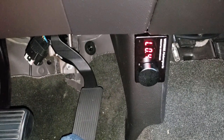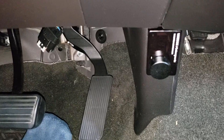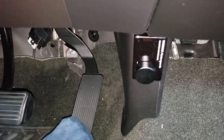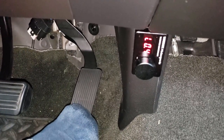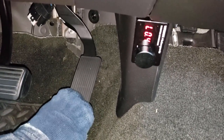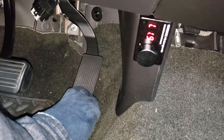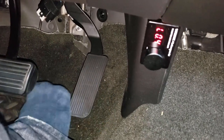We got the new pedal installed. After I took the old pedal out, the bracket flexes now ever so slightly, so I'm going to have to shim underneath the pedal. Initially when I looked at it, it didn't flex at all, but after I unbolted it now it flexes. Anyway, the voltage readings are the same — 2.1 fully depressed, 0.4 at rest. It does seem like it might — maybe just a feeling — but when you press it down it seems to get up to a higher voltage a little bit faster. It takes a really long press to get all the way up to the maximum voltage.